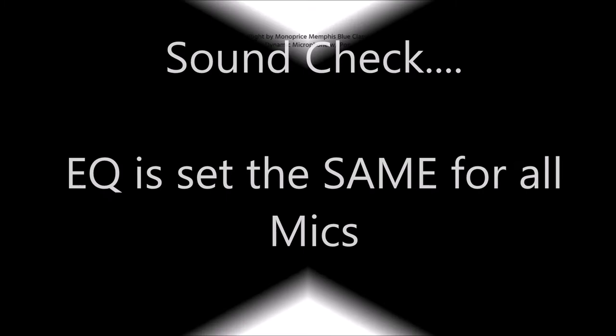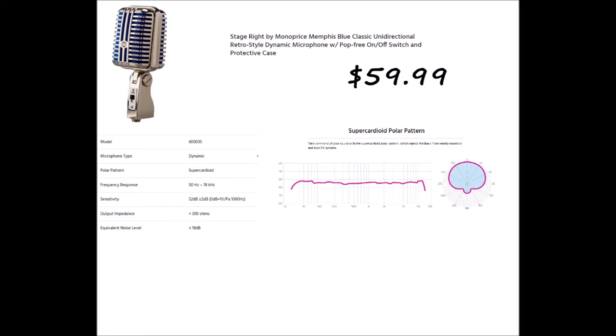Okay, this is the sound of the Stage Right Monoprice Memphis Blue microphone recorded from about 6 inches away. It does take a good deal of gain, and we will post the specifications up there on the screen for you. The manufacturer's website does declare this to be a super cardioid. My mistake, I believe I said it was just a regular cardioid. And we can come into it and talk to it from about 1 to 2 inches away, and you can hear the proximity effect.